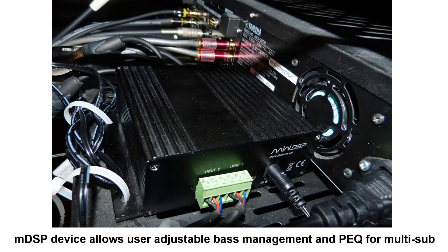Power towers are a great option if you don't have space for separate subwoofers — you're basically getting two subwoofers in one, which gives you multi-sub benefits. The speaker locations may not be ideal for subwoofers, but EQ can help. Using line-level connections to the power towers lets you take advantage of built-in parametric equalizers in many processors and receivers, or you can add a miniDSP to your subwoofer output. This lets you EQ the bass, tame room modes, and improve positioning. Multi-sub widens your sweet spot, gives more consistent bass seat to seat, and makes EQ more effective.